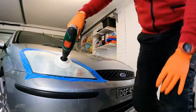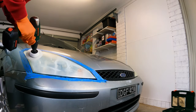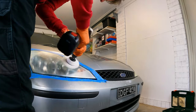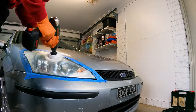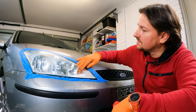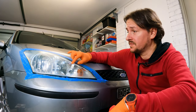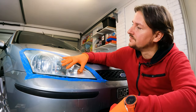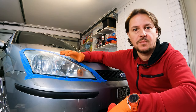Put a little bit of cutting compound on the headlight, rub it in before you start spinning, then off you go. Just keep going until all the compound disappears. That's a pretty good first pass — a lot of the milky haziness has gone away. You might have to do this a couple of times. I'll do the separate section next, then give it two or three passes until you're happy with the clarity.